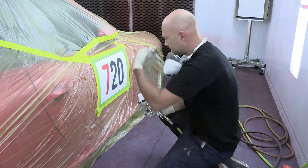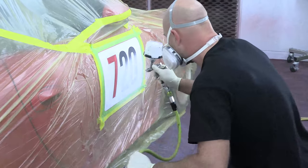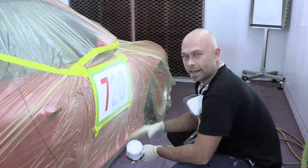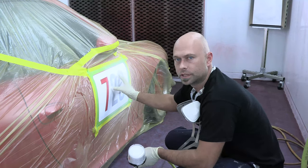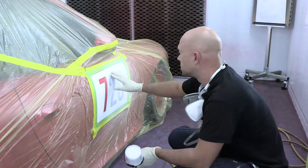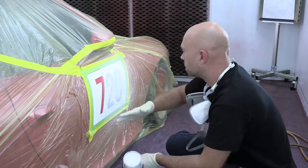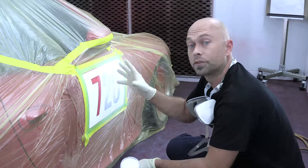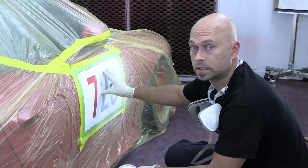This is coat number one — this is what it looks like. Welcome back: coat number one is totally dry and this is exactly what we want. You want this product to be dry to the touch before you go on your next coat. That's going to help with two things: how fast the product dries, and in terms of film build, it's going to allow this to really lay down nice and flat and smooth. There's no reason to put heavy wet coats on — in booth conditions with air movement and a dryer, this was dry to the touch in under five minutes.